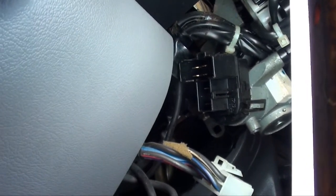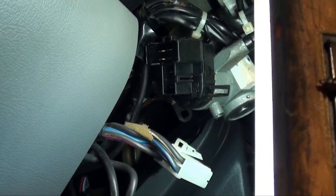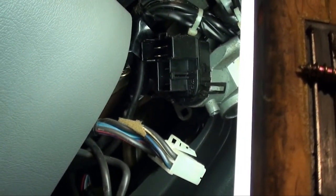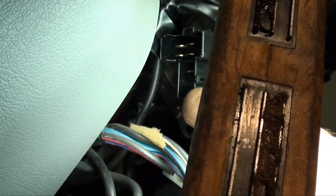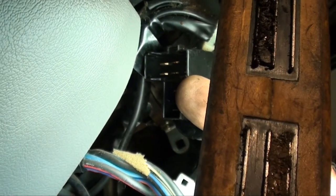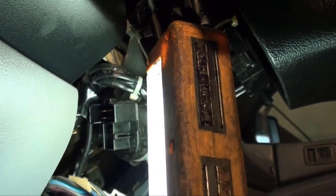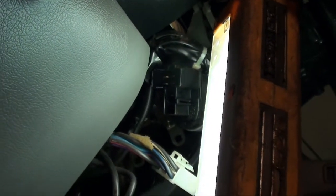Okay, from looking at the pinout on the schematic, we know we should have continuity in start from B1 to the start terminal. So since this is upside down, B1 will be this lower terminal, and the start terminal will be the lower right on this side. Okay, let me get my alligator clips and set my multimeter, the DVOM, to continuity, and let's check this switch.